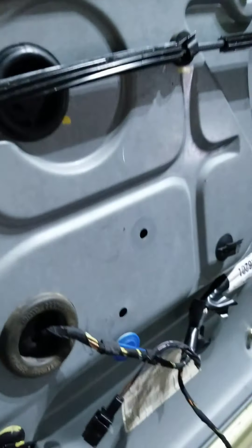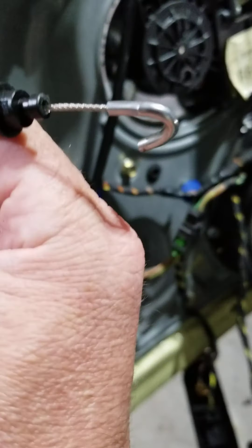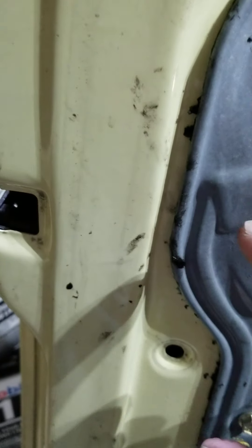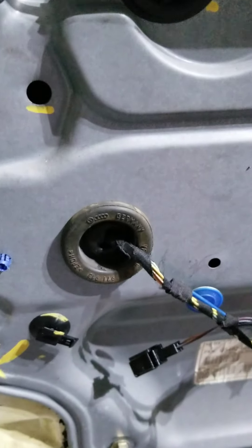The problem with taking the hinge out is these are not Torx bits — they're 12-point, used on Volkswagen half shafts. So I had to use vice grips because I don't have Volkswagen tools. I took that loose because I had to replace the door cable — the handle was broken off on the end. So I had to take that off anyway. Got that connector off, but I just left it hanging.